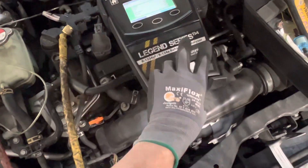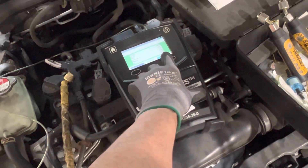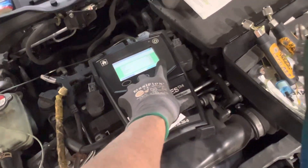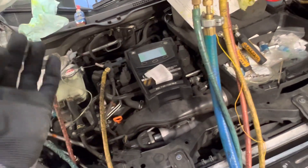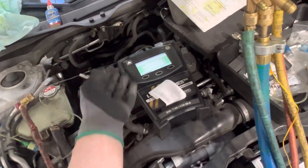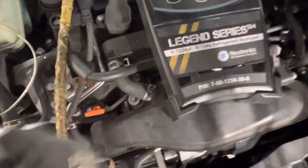You always do a visual, but you also always check and analyze the refrigerant, because that tells you a lot about the shop who worked on it before. If you see four percent air, six percent, eleven percent, fifteen percent — that tells you about the knowledge, quality, and mindset of that shop. If they're a hack shop, unknowledgeable, just don't deserve to be working on cars — this will tell you. Then you have to be careful, because you have a man-made problem, not a naturally occurring problem.